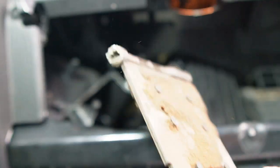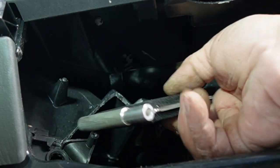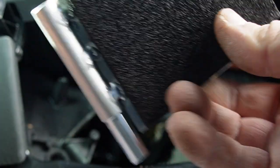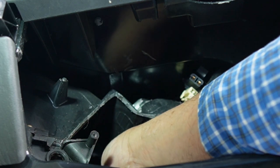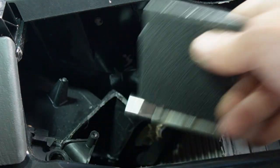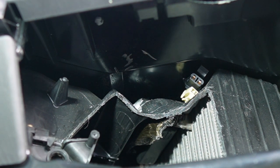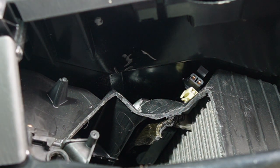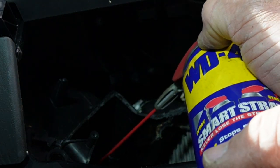There's our other blend door from the back. That must stay, so let's take our back blend door and put it in. It does not want to turn very well, so I'm gonna get a little bit of oil and spray in there on that. It's not exactly the oil I would want to use, but it's the first oil I seen — so we're going to hit it with a little bit of WD-40.